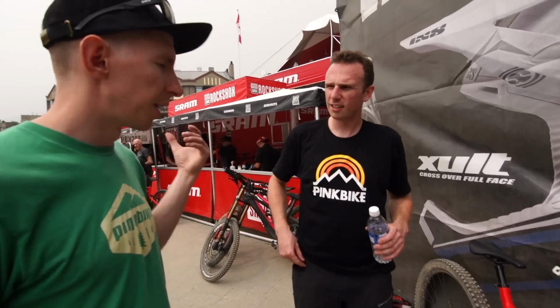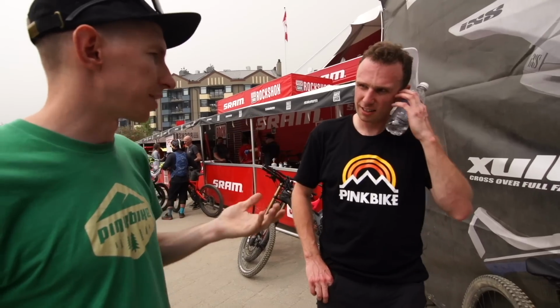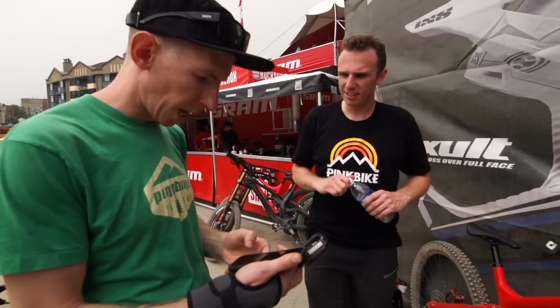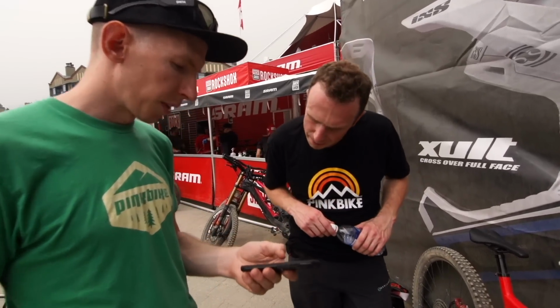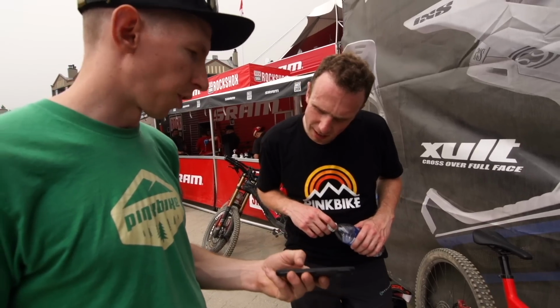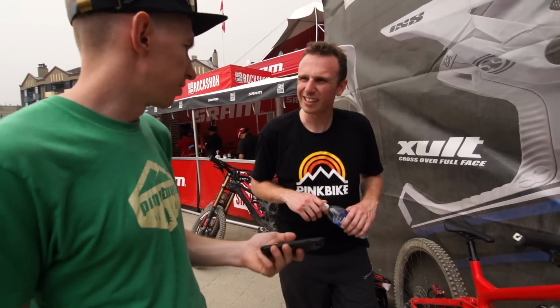That can happen sometimes, even just in the park setting, because of the bouncy nature of the trail. This is just a computer, it doesn't know what's happening. But for suggestions, it's saying your low speed rebound can get a little bit slower, and high speed compression get a little firmer. You don't have high speed compression, so that's not something we can adjust.